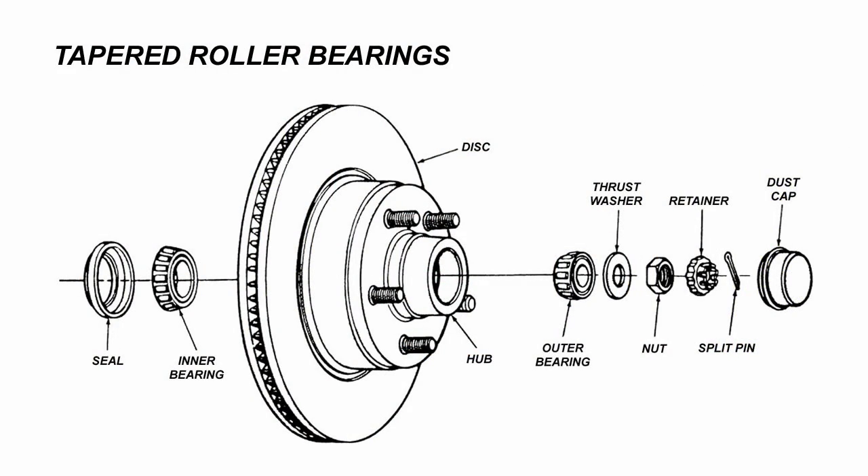Trailers have them too. This bearing basically consists of two conical shaped roller bearings. These run in races in the hub and you adjust the preload on these bearings by tightening or loosening the hub nut itself — pretty simple in concept. But before I get to the nitty gritty of it, first I'm going to show you how to check the current condition of your wheel bearing.